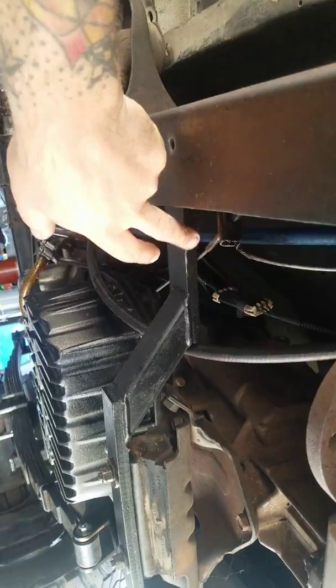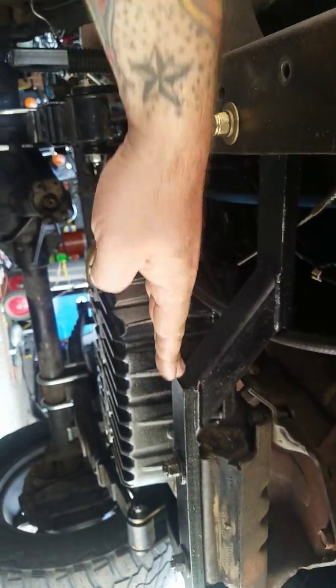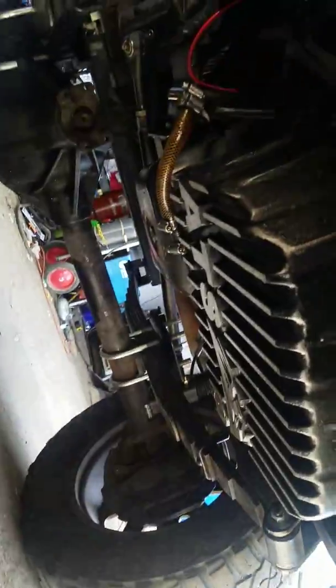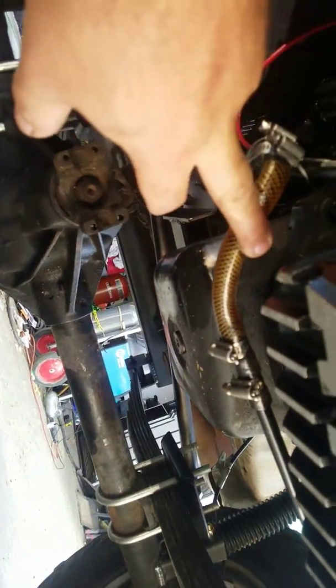There's a G2 diff cover. There's your Dodge transfer case. Carrier bearing and stock front output — I believe the driveshaft is going to intersect this crossmember, so it may have to come over and catch the bottom of the frame rail to reach that pinion. These are Off-Road Design hanger mounts. These are brand-new made-in-China leaf springs. There's your ATS deep pan — I had one of those bust on me on the freeway, so I did a little custom connector.